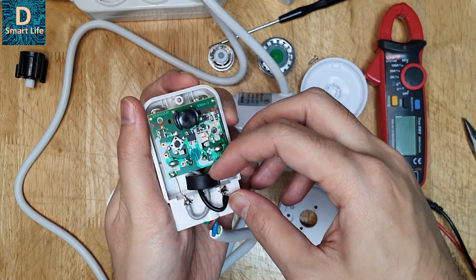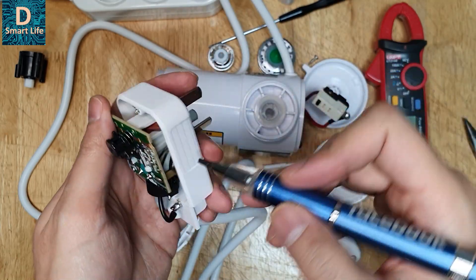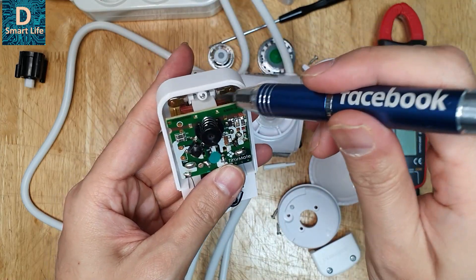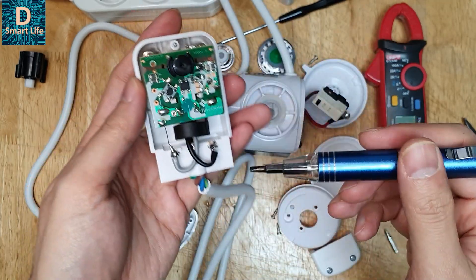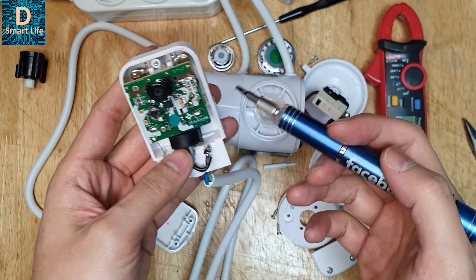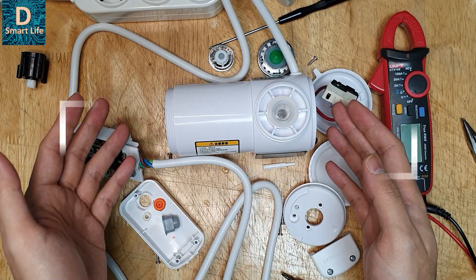This is the protection device. They have a current sensor here, and the actual cutoff mechanism is a physical switch. When the leakage current exceeds 10 milliamps it cuts off the physical switch, disconnecting both live and neutral — so the cutoff mechanism covers both channels. It has a current sensing coil that senses the current going in on the live and returning on the neutral; if they don't match due to leakage, the circuit breaks. That is the standard RCD or GFCI circuit, rated at 10 milliamps. That's it for today — thank you for watching and please consider subscribing. I'll see you next time.